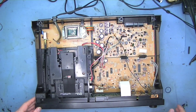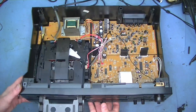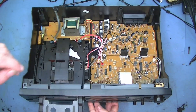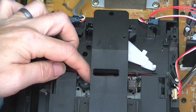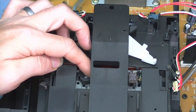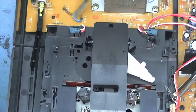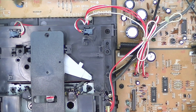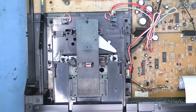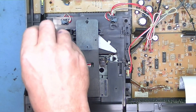It wasn't struggling to open, so first we'll take the tape out. You can see it's nice and smooth. We can now see the state of the pinch roller, and that pinch roller actually doesn't look to have had much use at all - unless it's been changed. That belt didn't look new to be honest, but the pinch roller looks suspiciously good condition. So this deck has had very little use, not been stored in a loft. It's just a case of the belt has dried out with lack of use.